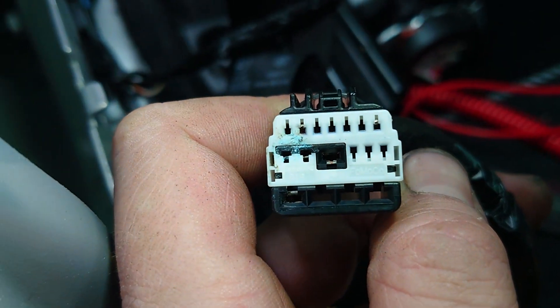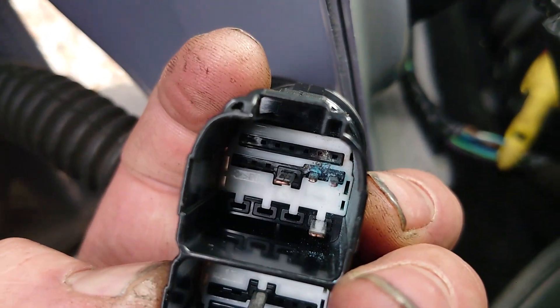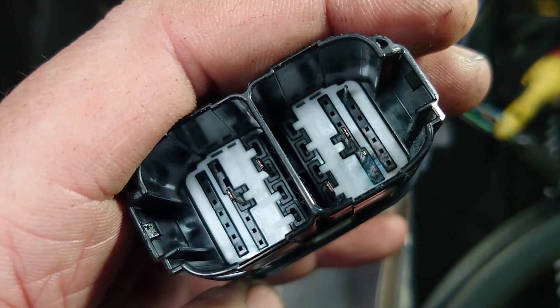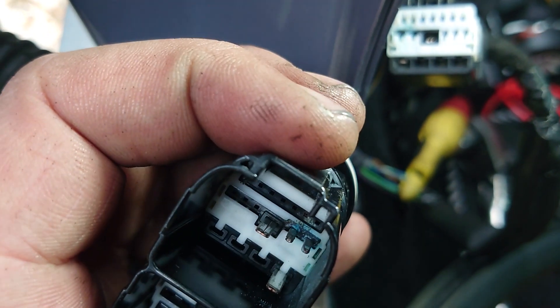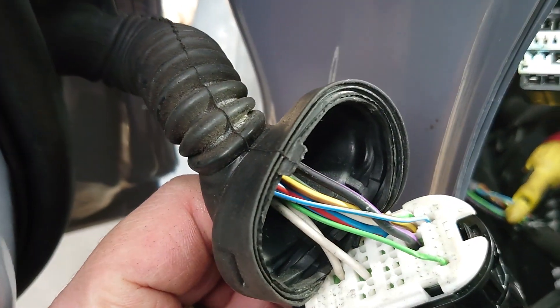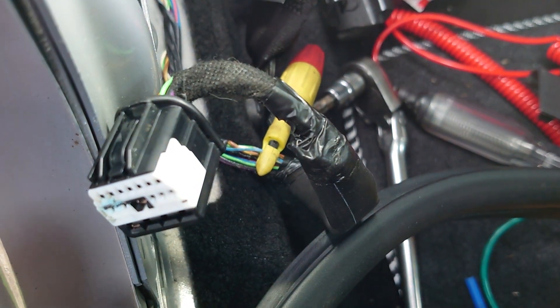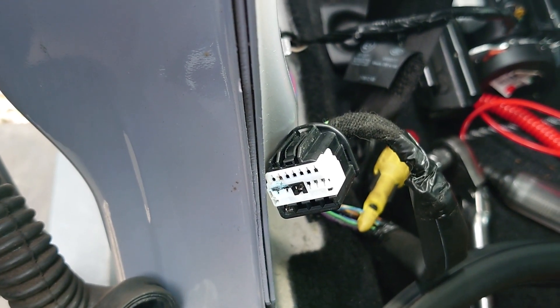Look at this — we've got the green wire, so it's that pin up there. But look at this side — supposed to be the top right, second one in. The pin's completely gone. I guess it's just stuck in there still, or it's completely disintegrated from corrosion. So that is definitely going to be our problem. Whether that 11 volts was tracking across from one of the other pins when back-probing, maybe. Anyway, it's going to need a door loom. I'll just jump the wire across to prove the point.